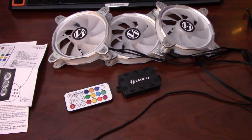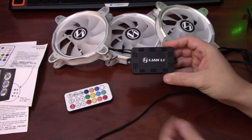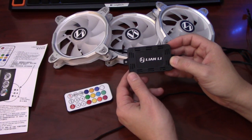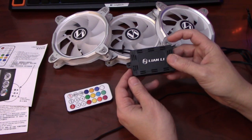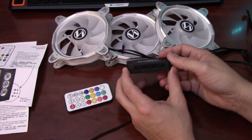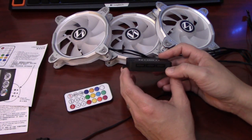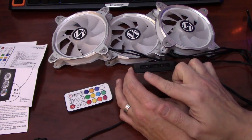I don't have any fancy way of actually measuring airflow, but I'll hopefully give you a better idea of some of the characteristics. With the Alpha 550 you'll get three of these RGB fans, and included with the fans is the RGB fan hub. This fan hub not only controls the RGB but all of the fans actually plug into it, and then it plugs into Molex power from your power supply. There's some adhesive on the back so you can stick it inside your case, and you have six fan plug slots here.